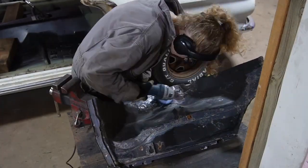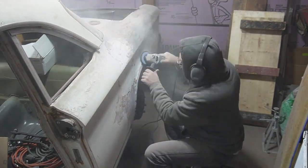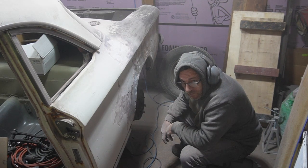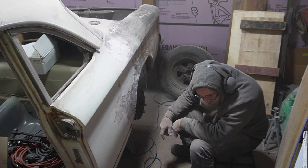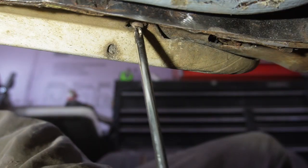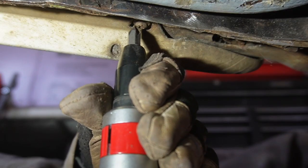After a while I finally got the power tools out and cleaned it properly — I don't know why I thought scraping was a good idea. In the process of cleaning the sills for the deck lid, dad decided to clean the paint off the rest of the rear quarter too, preparing it for body work. We'll come back to the trunk in a later episode — there are more decisions to make. We're going to need to get this rocker molding off. It looks like it needs a Phillips number two screwdriver — not sure what kind of clips are down the center since we've never dealt with one of these before. The screws won't come out so we may need to jack the front end up for more room.